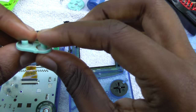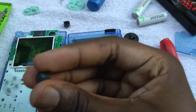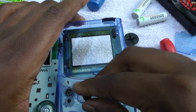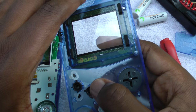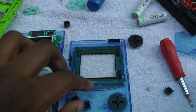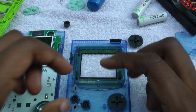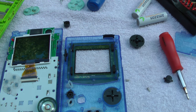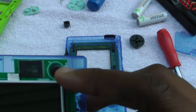There's nothing much you can really do about the start and select buttons — I don't have extra ones, and as you look at the contacts on the actual GB Boy board, they're spaced out quite a bit. I think if you want to mod in the original Game Boy start and select buttons, you'd probably have to cut them in half and space them out. I also found out that the A and B buttons don't fit because they're keyed — there are little pegs on the outside so you don't put them in the wrong slot. Because of this keying, you can't actually use them in the GB Boy Color, which is kind of disappointing.